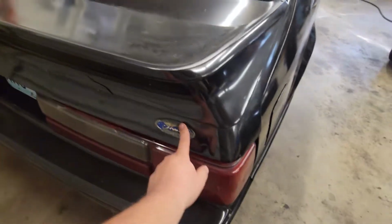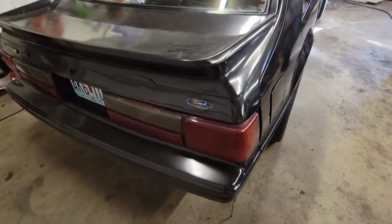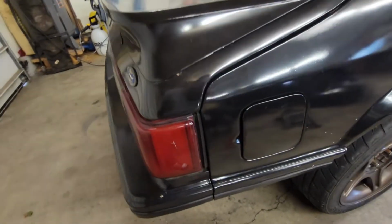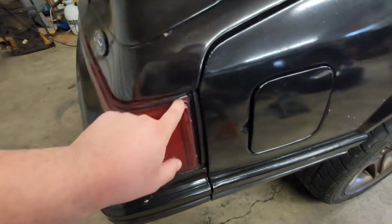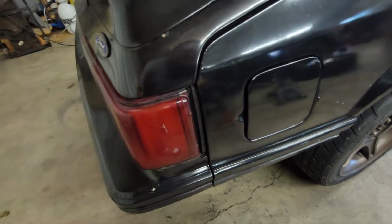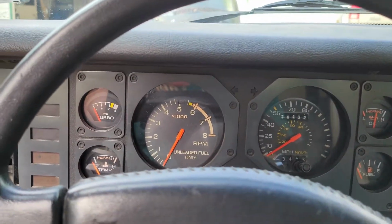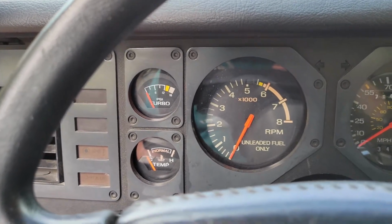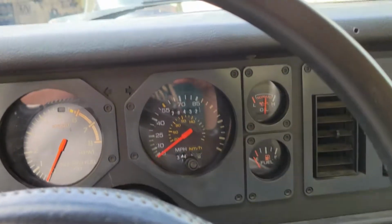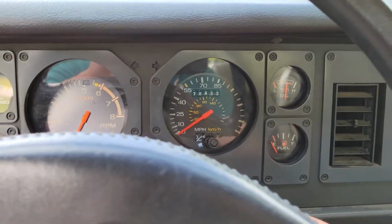A few things we're going to cover in the next video. I got to peel this off. I had the cover for this, and I forgot about it. I think I went down the road, and it came off. Also, my taillight has never been all the way in here. Somebody put this taillight lens on, and the little stuff that crams in there between the housing and the lens didn't get all the way stuck in there. Still don't have the tach hooked up or the temp gauge. Not that the Ford temp gauge really does me a great deal of good because it doesn't display specific temp. Fuel gauge doesn't work either, so I'm only using the boost gauge, the speedo, and the oil pressure gauge.